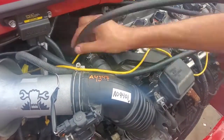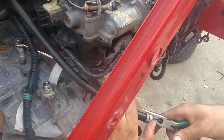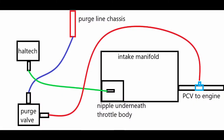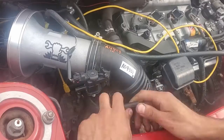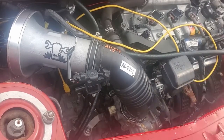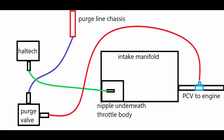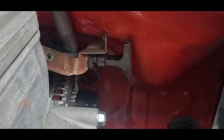What I'm doing now is hooking up the hoses to allow the purge system to work. Since the Haltech has a manifold absolute pressure input, I'll be connecting it alongside the system. The ECU port goes to the small nipple just underneath the throttle body. The purge valve goes to the purge hard line on the chassis and T into the PCV line that goes into the engine. You can use any generic quarter inch T. That T hooks up to the other side of the purge valve. As you can see my dipstick just barely touches the chassis, however it's still removable.